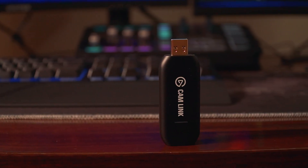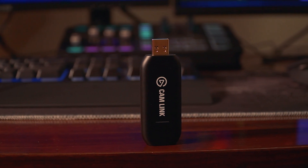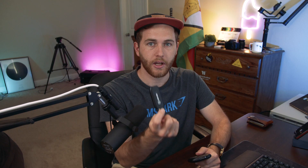There might be a 20 to 50 millisecond delay on USB 3.0, but that's very minimal — hardly even noticeable. My stream viewers haven't noticed it, so it's not a big deal. That was the one issue I had when I first got the Cam Link 4K — this is the 4K version, by the way. They don't differentiate clearly between the HD and 4K versions, so make sure you get what you're asking for. I initially used a USB 2.0 port, which caused about a one whole second delay — I almost sent it back before I realized I was using the wrong port.